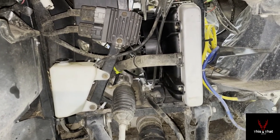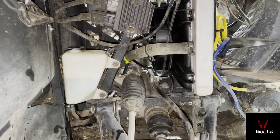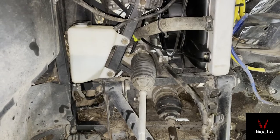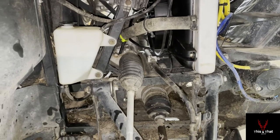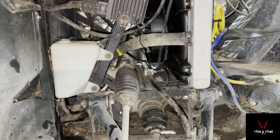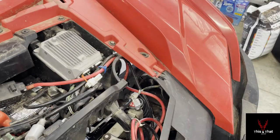The radiator is reinstalled — it's just as simple as reversing the removal steps, so I didn't film that. One thing to note before putting the strut tower and wheel back on: fill the overflow bottle on the left-hand side up to the full line. It's a lot easier to access with everything out of the way, so fill it up after the radiator's in but before reinstalling the strut and tire. Then we'll fill the radiator and get the air out of the lines.